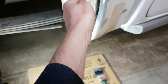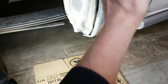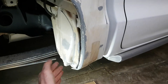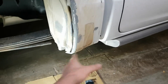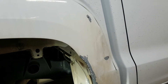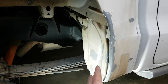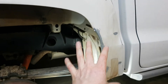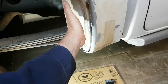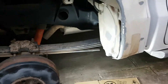This here is the main area. What I've done is cut the old lip off and then folded a new lip. As I mentioned in the previous video, it doesn't need to be pretty — it's all going to get covered by the flare. I've drilled the holes because I'm replacing the dummy bolts in the flares with nice stainless steel screws. Once I've put the inner guard back on and put the flare on, I'll use the heat gun to move the flare and inner guard further forward, and I'll have room for the tires so they shouldn't scrub.